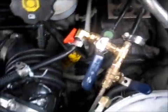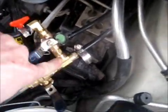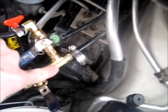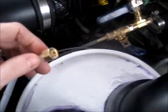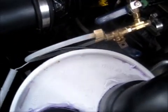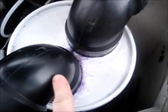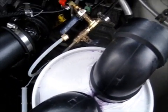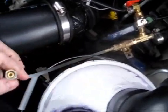Here is my valve setup for my fuel line. I tied into my fuel line and cut it, so right here I have a T with some barbed fittings. This side actually goes into my bubbler or gas vaporizer. I'm not connected right now — I had to fix the float assembly because it was pushing too much gas through. One of the pipes was hitting the valve so it wasn't allowing it to come up all the way to shut the fuel off, which filled up my bucket. I'll need a longer hose to reconnect it.